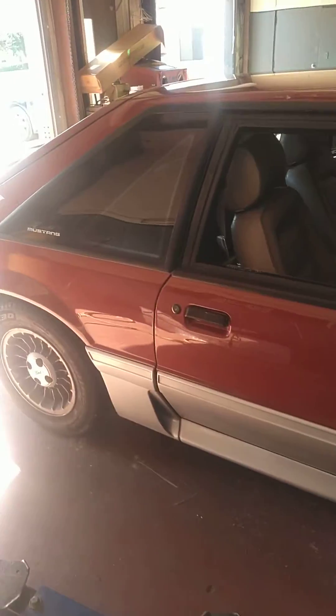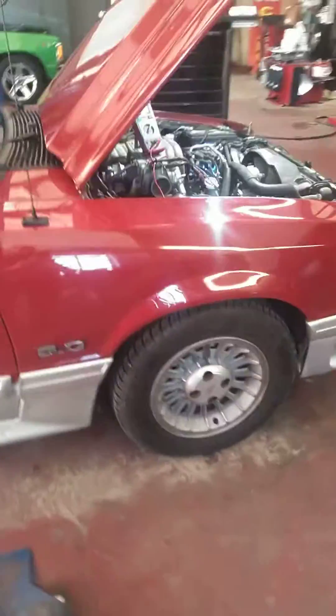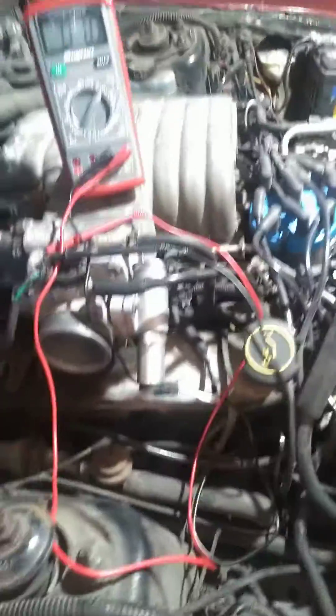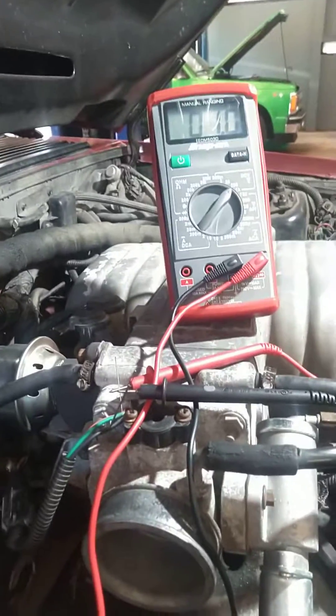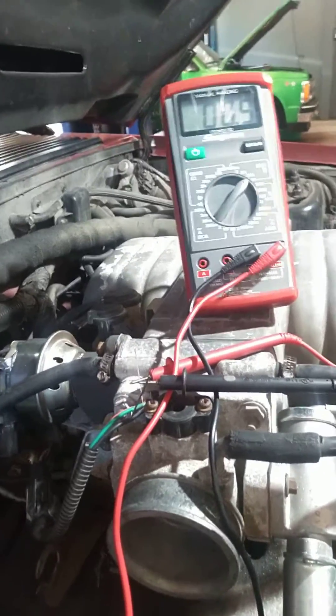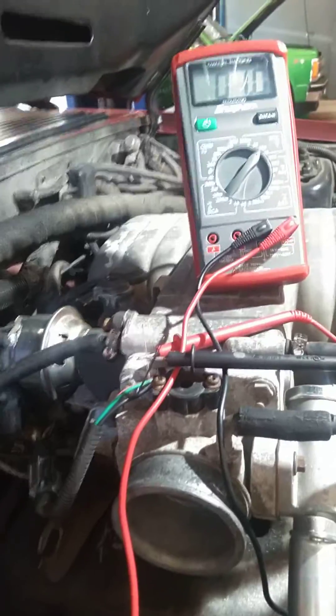All original, true survivor, no modifications, no nothing like that. Got the turbine wheel still on it. Today we're doing a throttle position sensor, making sure that it's still in spec. Now there's a lot of debate on where it should be voltage-wise. Whatever makes your car run best is all I got to say. It should be between 0.87 and one volt, give or take.